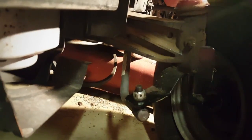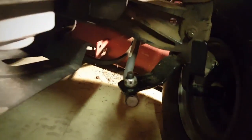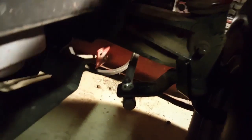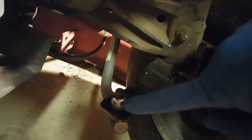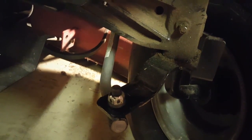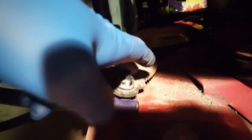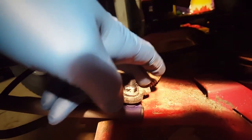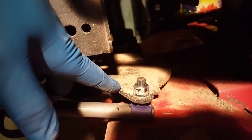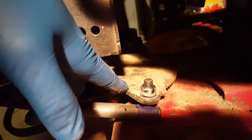Alright, the front's all mounted back up, good to go. Just a little tip: since it sits up underneath the A-arm, simply turn your wheel — that opens it up so you can get to this bolt and tighten it down. Now I'm going to go ahead and mount the steering control or spindle back up — it's got teeth and all that, so it's going to be a little challenging.